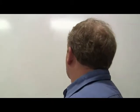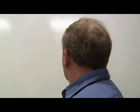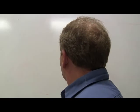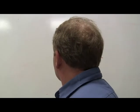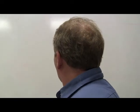Basically, the speedometer cable would spin a drum. The speedometer cable was a cable inside a sheath that came up here, running inside a tube, and it would hook into this little thing and snap onto this cluster. Up here in the speedometer, you'd have a metal drum like this with this thing spinning. I'm not drawing it perfectly, but it had a piece of metal in there, and right in the middle was a little hole with a bronze bushing in it.